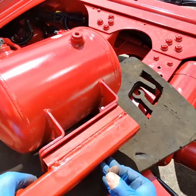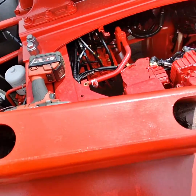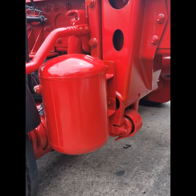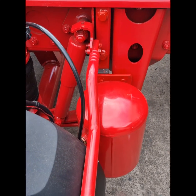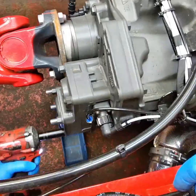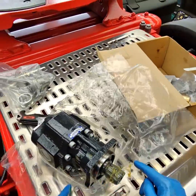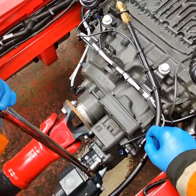With this now cut, we can get it all put back together and move on to the PTO pump. A slight bit of grease going onto the splines here because the book told me to do that. What a nightmare these PTOs are to line up. Ever seen a technician use a crow's foot on a torque wrench? Well now you have.